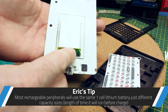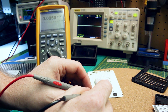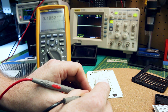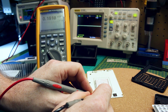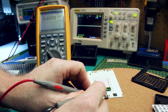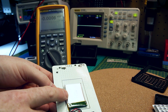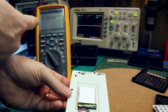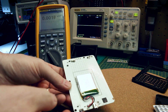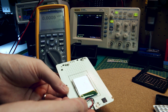This lipo battery is going to be the problem. If you have a voltmeter you can probe on the battery itself, and we can see on volts DC we only have 0.17 volts — not even 0.2 volts. This is why the unit's not charging. The battery got too low and the onboard charge circuitry won't kick in. Don't worry, you don't need a voltmeter — we can just change the battery.